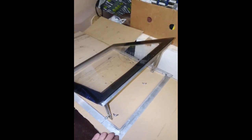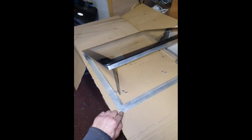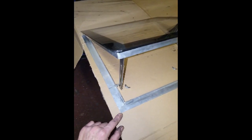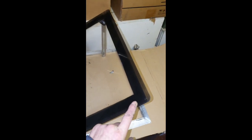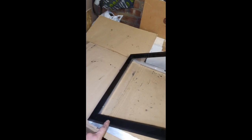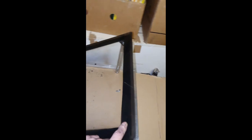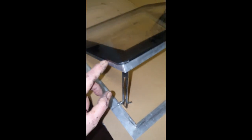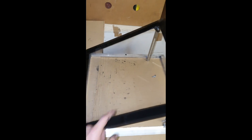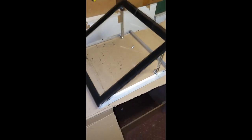The most important thing is to make sure that it's reasonably solid enough to fix beforehand, and make sure that the corners are sealed up. For the perspex, make sure you cover the seal on the top surface with some black paint or black strip, to stop sunlight degrading the seal underneath. You should try to protect the seal from sunlight if possible. You could use tinted glass. I just happened to get a clear piece of perspex, but you could use tinted perspex, which would perhaps work better.